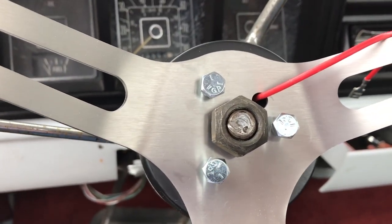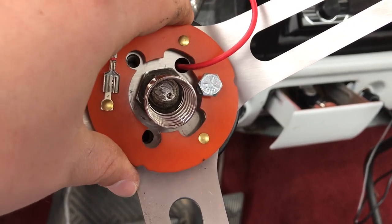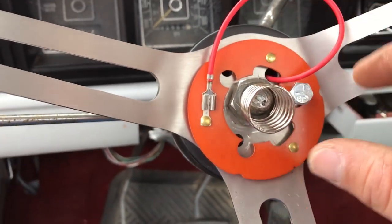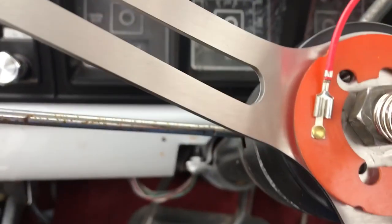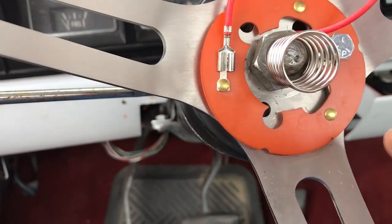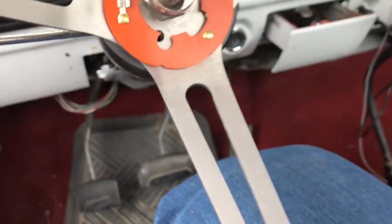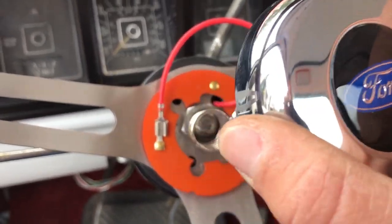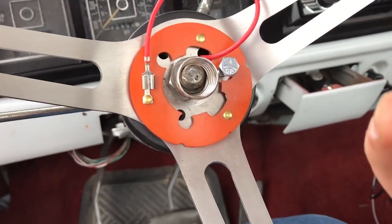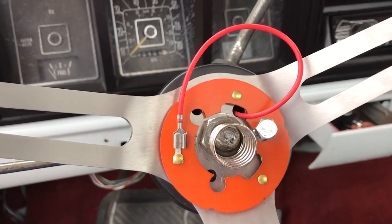This is how the horn button goes on. I had to take off these little shoulder bolts — that's what the instructions call them. This little contact ring goes on in this orientation and clips on right here, and this wire clips onto it. Then I put in the bolts, the spring goes against the horn cap, and the cap goes on and twists until it's tight. It's a little fiddly but I'm going to get it done.